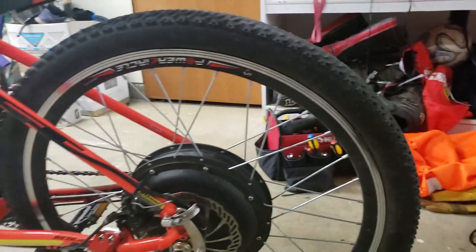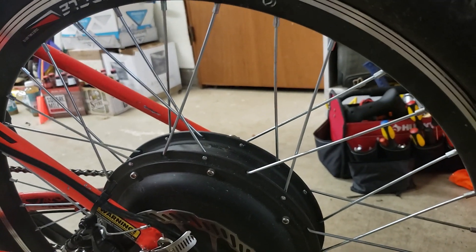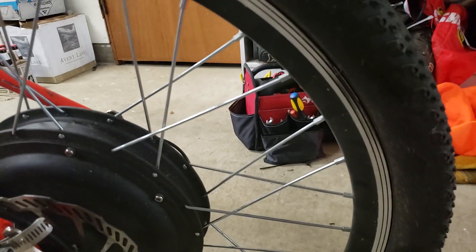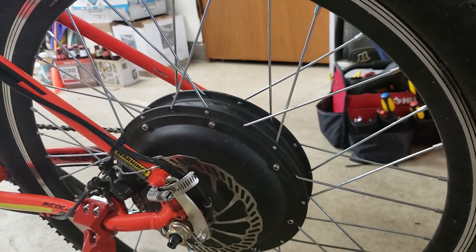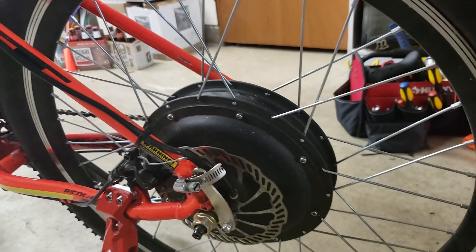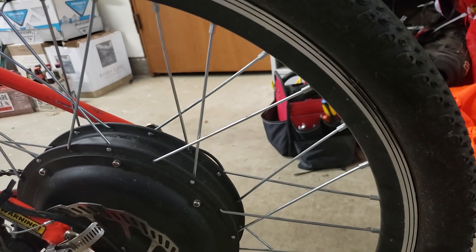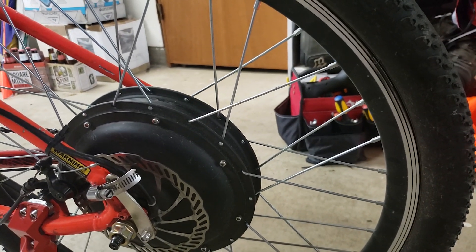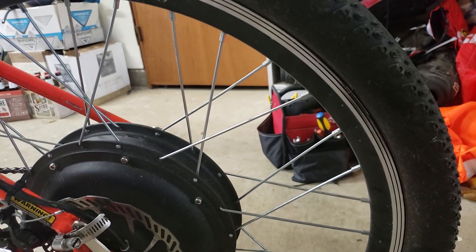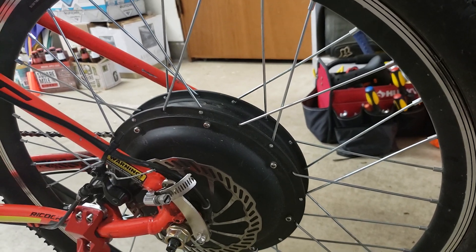Another thing — on the inside wall of the wheel they don't put rim tape, so the spokes can go right into the tire tube and pop it when you hit a bump. That happened to me twice. Also, with the extra weight of the e-bike on the rear, you can easily get snake bites — that's where the rim pinches the tube against the ground, leaving two holes on either side of the tube. I just wrapped electrical tape around the rim twice instead of buying rim tape, and it's worked — no punctures since.